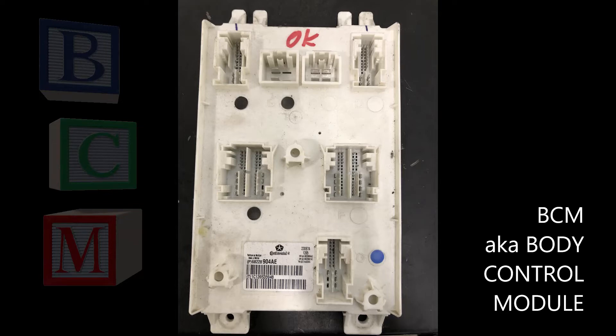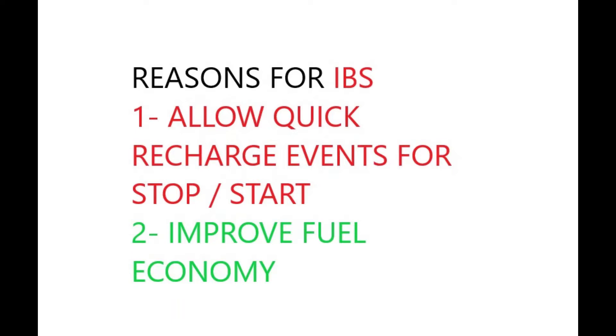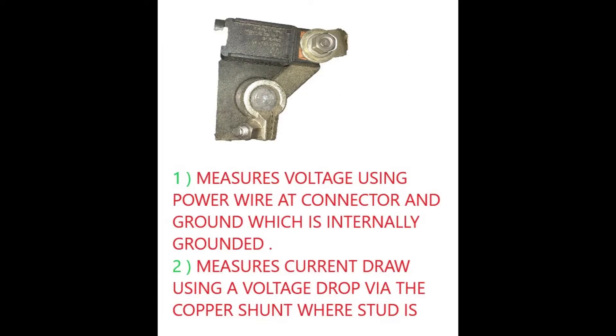Some of the reasons that we have the IBS sensor on Chrysler Dodge Jeep Ram is because AGM battery technology requires a closer control of battery charge rates — how much electricity goes into the battery in essence. We also want to have fast recharge rates after a stop-start event at a stoplight. So when you come to a stop, your engine shuts down, we need to charge that battery up pretty quickly. Without the intelligent battery sensor, that would be more difficult.